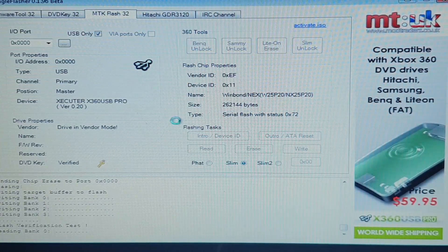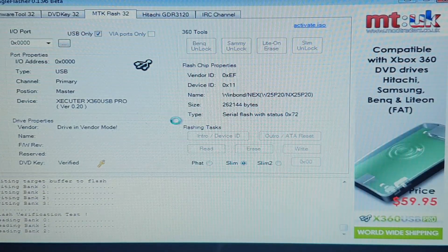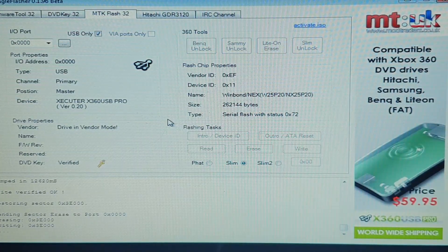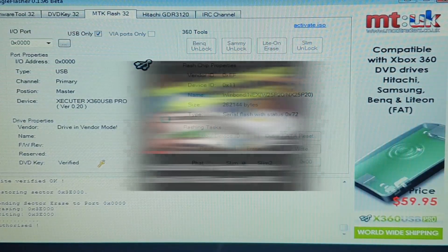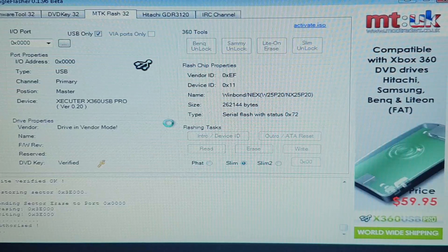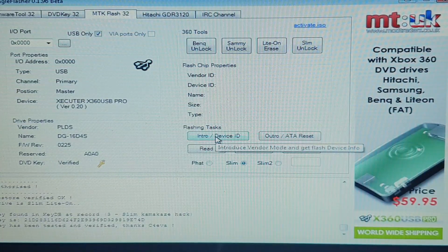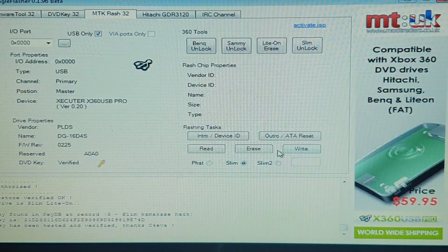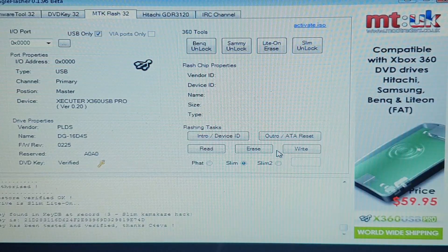As I said previously, if you were putting this back into another Xbox you'd lock it back down, but we don't need to as it's going into an RGH. If you've not seen my previous video on the D5S one, there'll be a link at the end. This looks all good - still in vendor mode, it's authorizing and setting that firmware up. To lock it back down again, you click intro, switch it on and off within that second, it should go back into vendor mode, then click on that and it will lock it automatically - just follow the on-screen prompts. It'll show SPI back as 0xC or 0x8C, something like that. So I'm going to put it all back together.